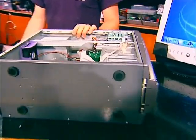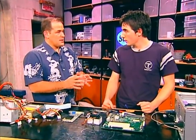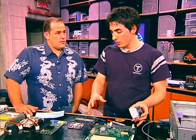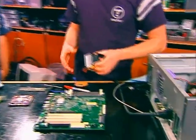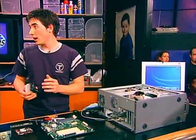This is a single 1 gigahertz processor motherboard. Apple doesn't even sell a single CPU machine anymore. What would happen if you built a dual CPU machine? That's going to be tricky — you'll need a bigger heat sink — but you can do it. They do sell dual processor motherboards, and you can pick up another Sonnet 1 gigahertz chip. You really have to focus on cooling and put an extra fan on top to keep the CPUs cool.